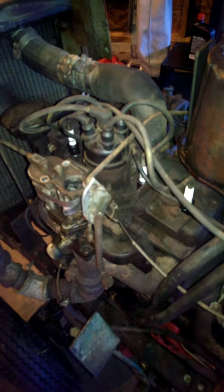And I think that was it. Those plugs were done to begin with, and that little bit of oil mixed gas followed them out, and it was only popping on one. Put the brand new plugs in it, and man, she's popping on all four now. Plus a stuck valve.